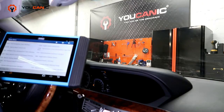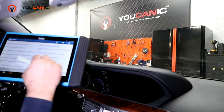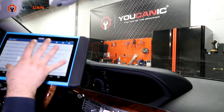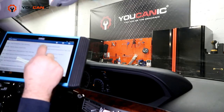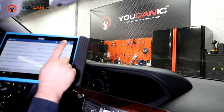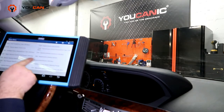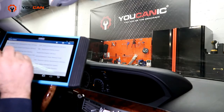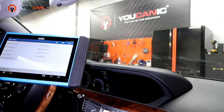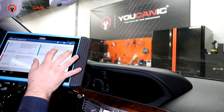Go to system selection, select your make and model — it's best to just enter the VIN to get the right vehicle. Once you're in the main menu and connected to your car, go to 'Control Unit,' then 'Chassis' — on a Star Diagnostic you'd click next and then chassis. After chassis, go to 'Suspension' or 'Air Suspension,' turn on the ignition, and then read the fault codes.